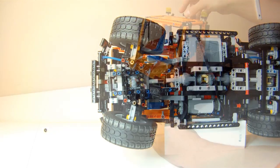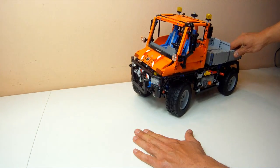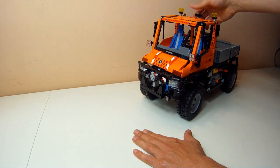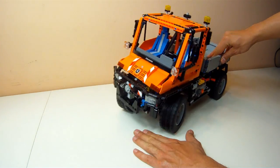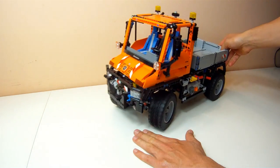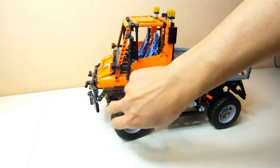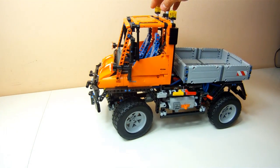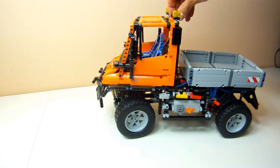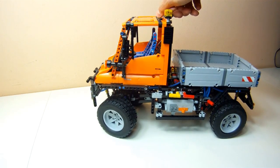So the combined effect is this. A lot of force is required to steer the car, which makes you absolutely powerless when it needs to negotiate any kind of obstacle. As soon as a wheel hits any kind of imperfection in the surface, it will deflect to that side and there is absolutely nothing you can do about it. I have tried to anticipate this and applied force to the steering in the opposite direction, but the wheel deflected anyway and stayed there, because the suspension geometry is all wrong. It does not return to the straight ahead position.